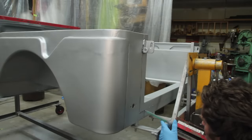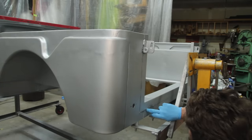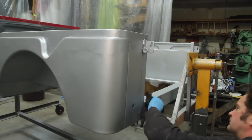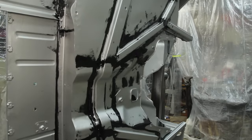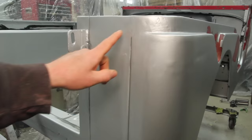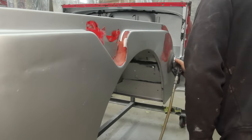I did a second coat of primer and now I'm seam sealing everything. It looked like almost all of the rot on this started where panels overlapped, so the more I can do to prevent moisture and dirt from getting in there the better. I made a giant mess doing this, but all of this will get covered up with bed liner eventually. I want to wait until I have all of the other brackets welded in before I bed liner the inside. I did do all of the seam sealing on the outside, and I shouldn't have to add any brackets there, so let's turn this thing red.